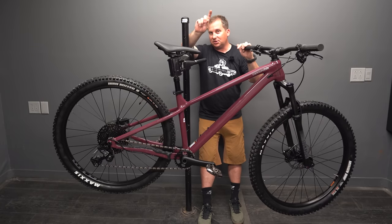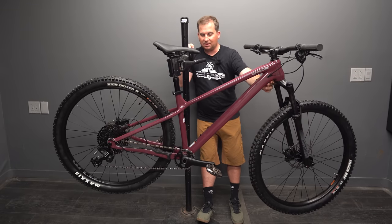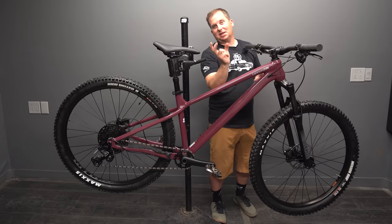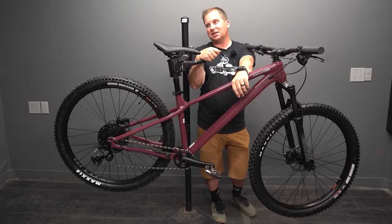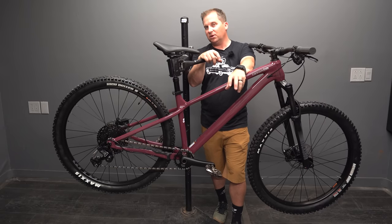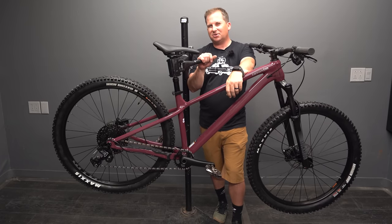There's a couple things I don't love about this. I don't love the cable guides. They're just a little bit hokey. The little cable entry ports there, it pinches your cable pretty hard, which I don't love. It's also got one of those plastic cable guides under the bottom bracket, and it screws on with a Phillips. Like, that just screams saving 20 cents for not just having a hex head on that, because Phillips will strip out. And I actually had to pull that off when routing the dropper so I could fit the dropper through there. And I was just a little disappointed.